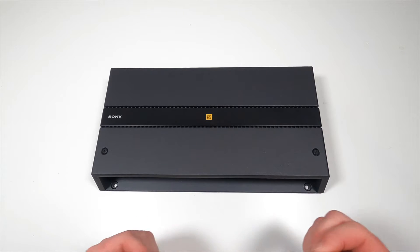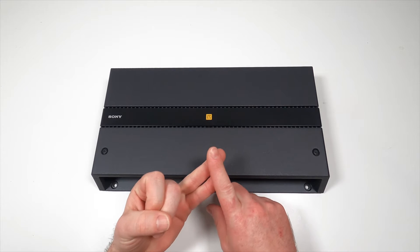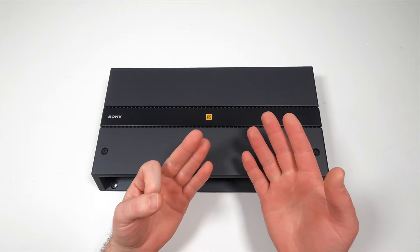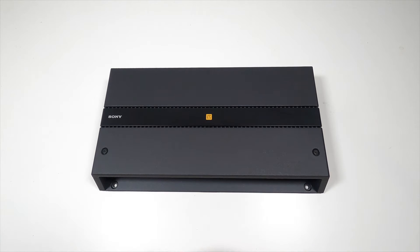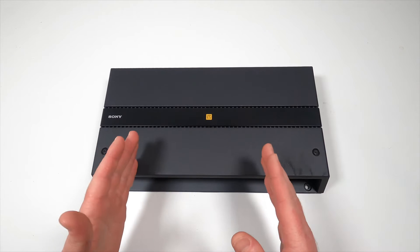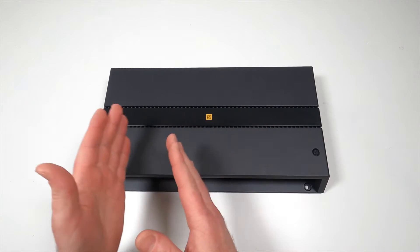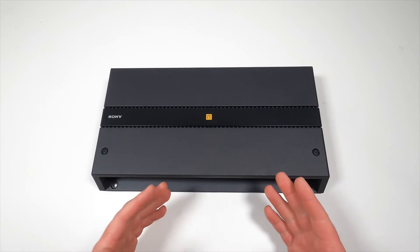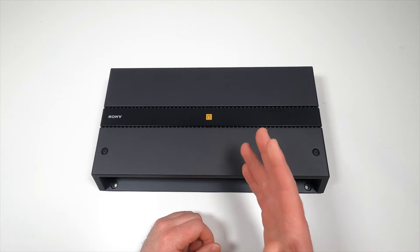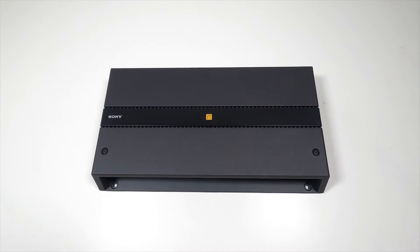This is for an install on a Ford F-150. This truck has a three-way system in the front complete with a 6.5-inch woofer, the 3.5-inch mid-range that are in the dash, and a 1-inch tweeter in the A-pillars of the front. It also has 6.5-inch coaxials in the rear. I'm going to bi-amp the front three-way component system so that I can separate the mids and tweeters from the woofers, and ultimately set the gains and levels for those two separately. The reason is that the two added 3.5-inch mid-range speakers positioned in the center dash are just too overbearing — the combination of those tweeters and those 3.5-inch mid-ranges is just too much. The crossovers that come with those speakers allow for bi-amping.